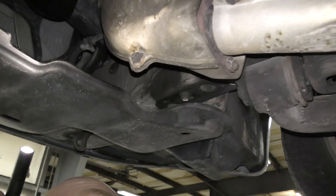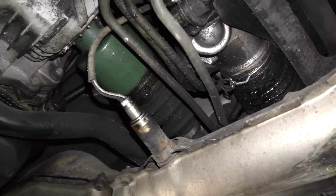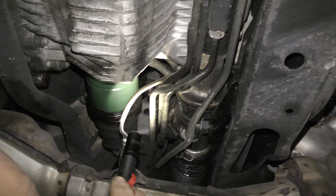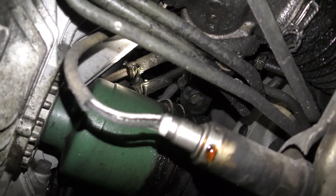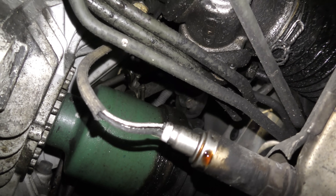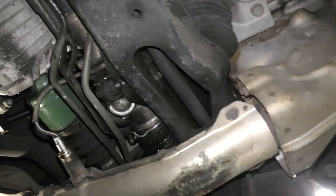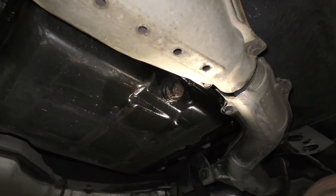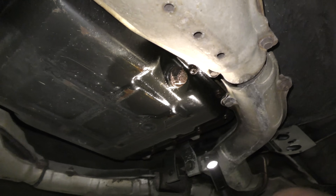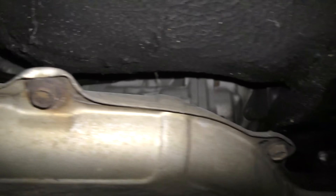I do see a little bit of a leak back here too. Another loose hose clamp — same scenario, transmission fluid leaking down. Another easy fix. All this fluid on the belly pan is coming from those two leaks up front blowing back, so fixing those clamps will very likely take care of all of it.